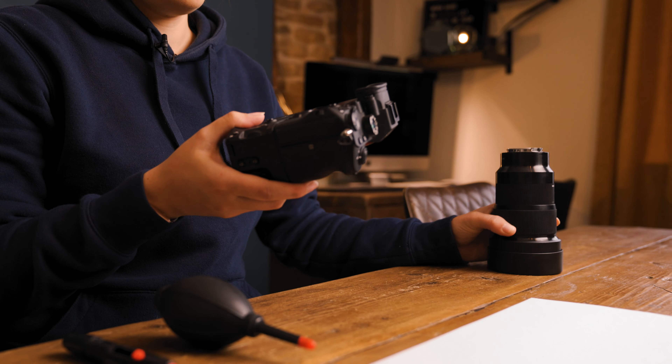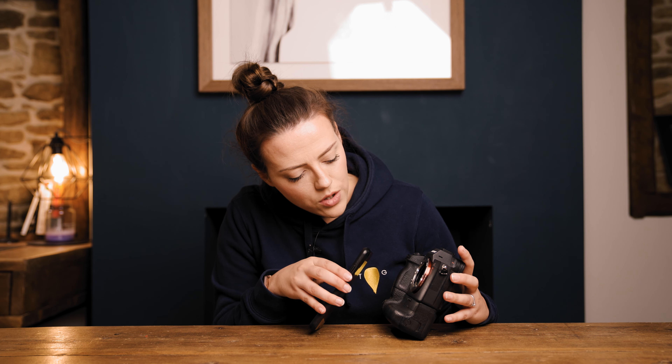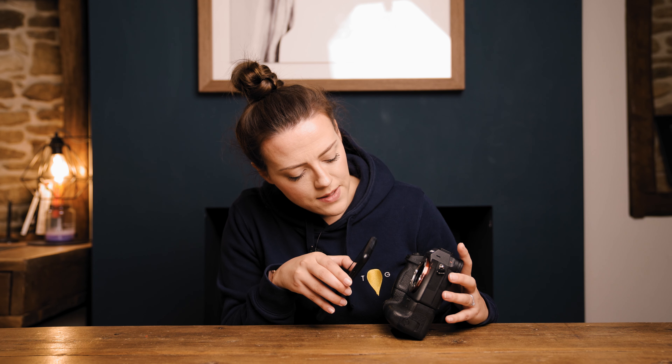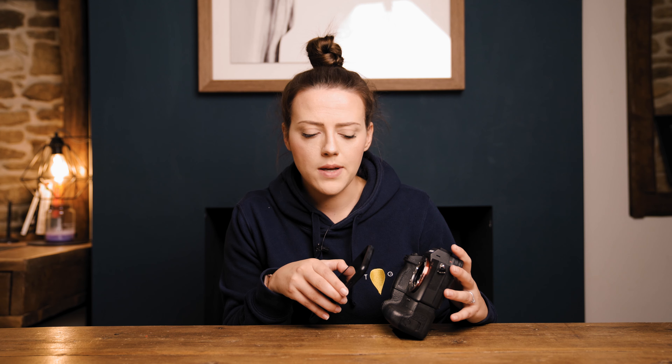Remove the lens from the camera. With the lens removed, go ahead and grab a torch and look inside your camera at the sensor. See if you can spot any of the dust spots you identified earlier when photographing the white piece of paper. I can see a lot of mine — remembering they are upside down, because that's how cameras work. See your dusty bits and keep a mental note of where they are. Ideally, don't faff around talking with your sensor pointing upwards like I'm doing — assess the situation quickly.